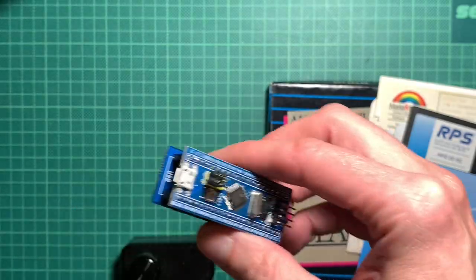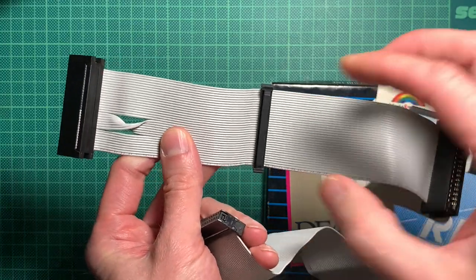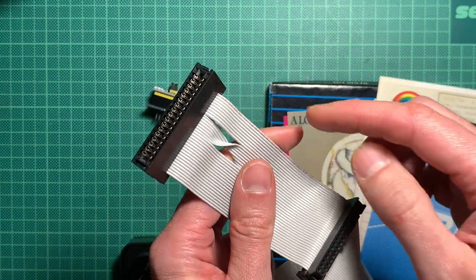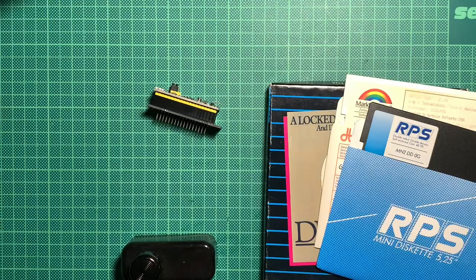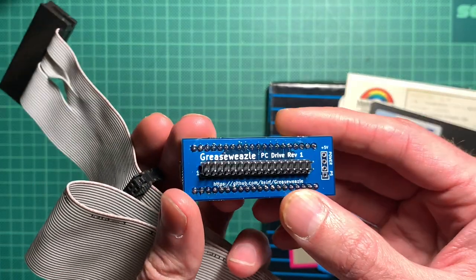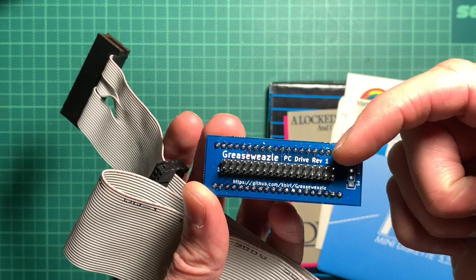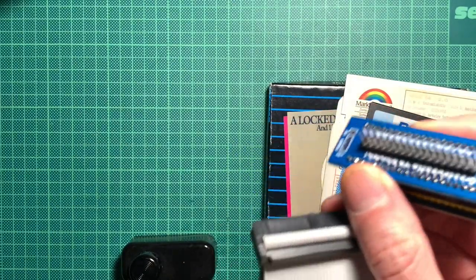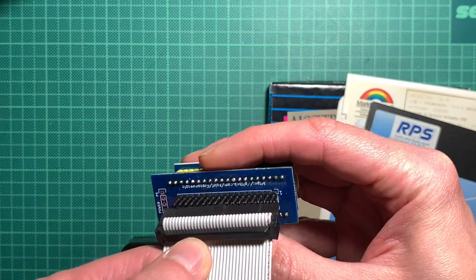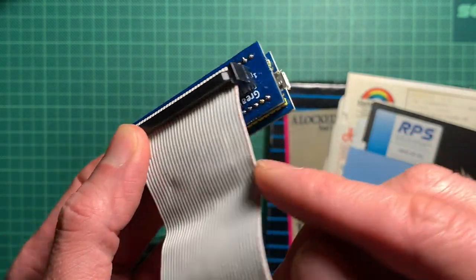You will need a floppy drive cable just like this one. PC floppy drive cables come with a twist at the position where drive A is — so this is drive A, which is a edge connector for a five and a quarter inch drive, PC or C64. You have to take good care to attach the cable correctly, because there is a '1' marking pin one, but there's also a '1' marking the revision one of the board — I actually made that mistake once. The floppy drive's light will stay on if you do that and you should turn off the machine immediately. The red marking on this side indicates pin one.